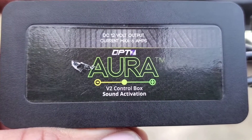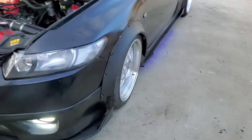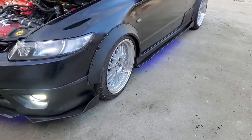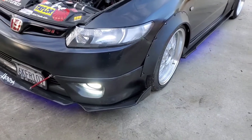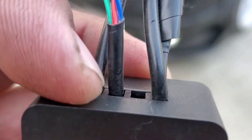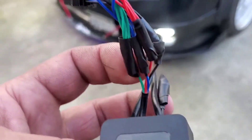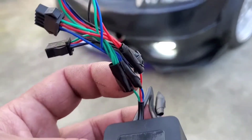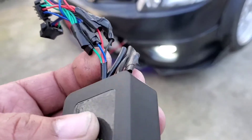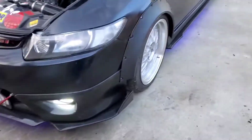It's been a couple of days already. When I was installing this one, I had an issue with one of the lights — the rear one. Right now it's daytime and you can still see them; they're pretty bright. One of the pigtails for the cable came loose right in here — you can see it missing there. So what I had to do was wire all of them into one, so it's one lead going into all four pigtails, and that's how I was able to get it to work.